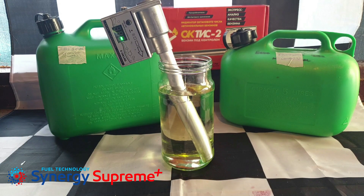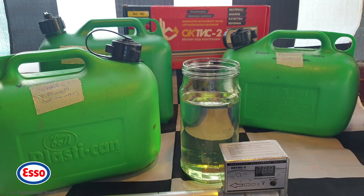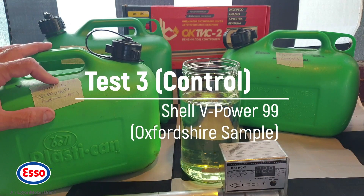We've got 93 again. So these fuels are pretty clearly coming from the same source despite the different garages. That is a little concerning — Esso Synergy 99 is not reading anywhere near 99. I'm in a slight state of denial because I'm questioning the accuracy of the tester, but I've been doing plenty of tests with it and it's been giving consistent results, showing fuels at or slightly exceeding their advertised octane ratings. What I'll do for this next test is just test the freshly bought sample of Shell V-Power.